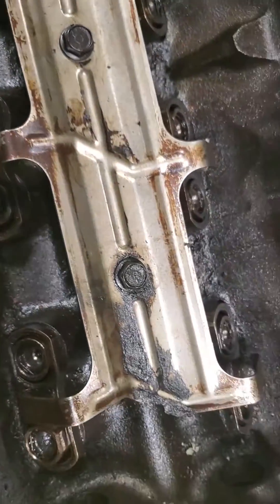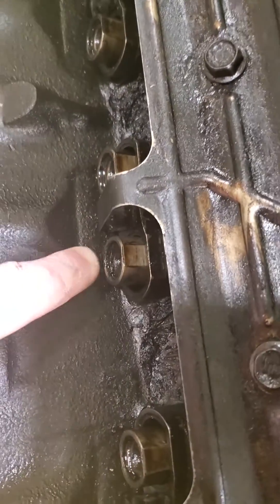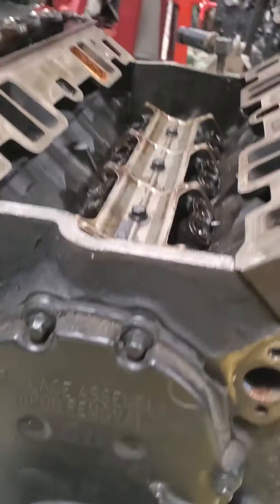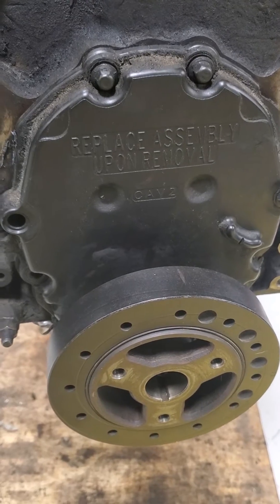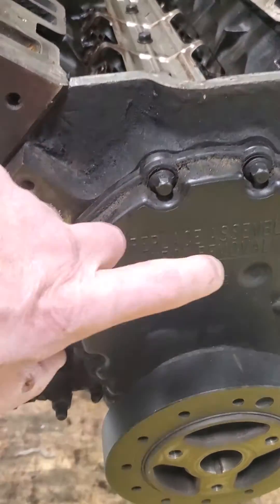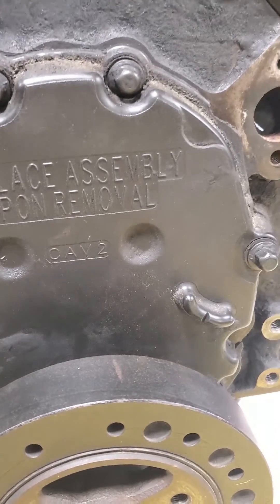That's what this lock mechanism indicates, and you can really see they're slotted — so you can see that they cannot rotate. Another telltale sign of a newer style 305 or 350 is that the timing cover is composite, and this is a one-time use timing cover — you have to replace it.